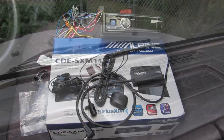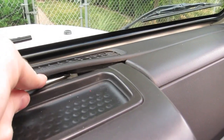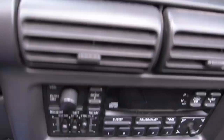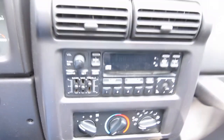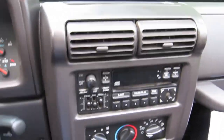The first step is to take off the defroster plate. Run a screwdriver under it — it just has some clips and should pop right out. Once that's out, there are two screws up underneath, and inside the ashtray is another screw. Take those off and the whole panel should pull out.